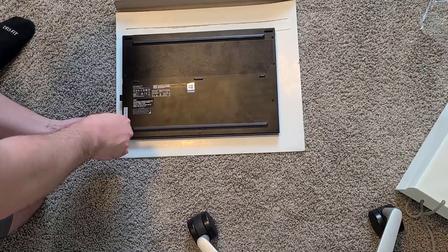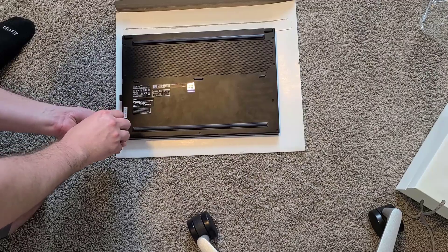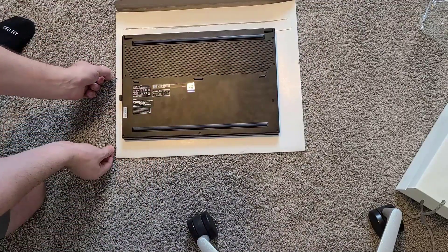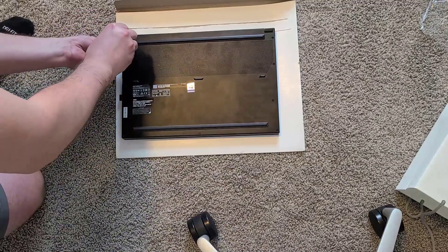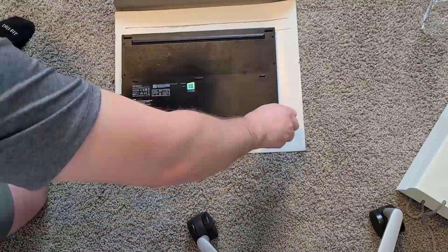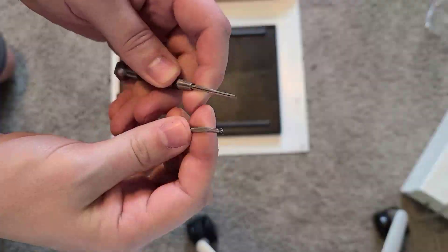It's not a full teardown and upgrade — it's basically just to get you comfortable with the parts and pieces that you'll need in order to do that. So if you've got a precision tool kit, which is essentially really tiny Phillips and flathead screwdrivers, you'll be able to do it. Notice how I'm putting the screws in coordination with the holes on the back plane of the MSI laptop — I'll speed through it quickly, so every screw goes near the hole it came out of, to not confuse them.